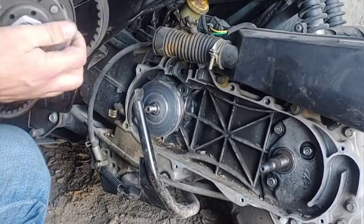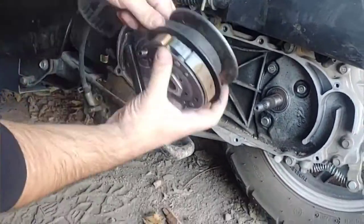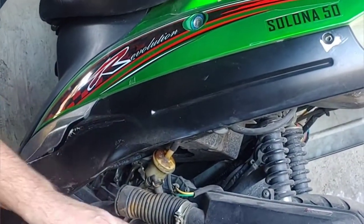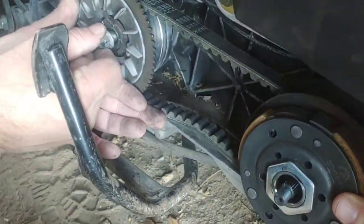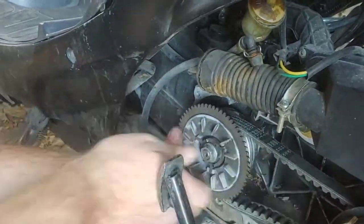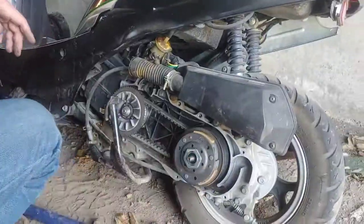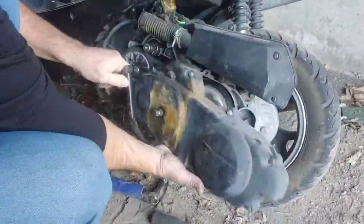I don't take the variator apart — I don't need to. I can hear everything's working behind it. So I squeeze the pulley back and get the belt as deep into the clutch pulley as I can. What's really critical here is these are splines on the end of the crankshaft, and the center of the starter gear slash half of the variator pulley — it is really critical that you get those splines started nice and square. Because if you don't and you just hammer it on there, you're going to regret it. You're going to have to buy some parts or do something crazy. So just make sure those splines are lined up good before you crank it down. It's a tight fit, but the starter gear does fit in there.